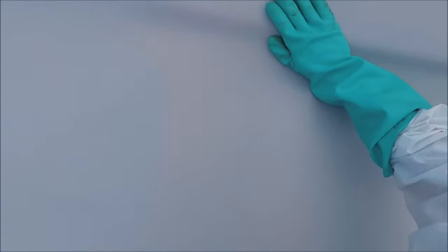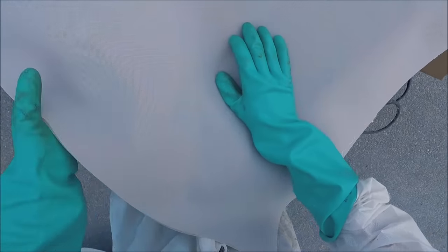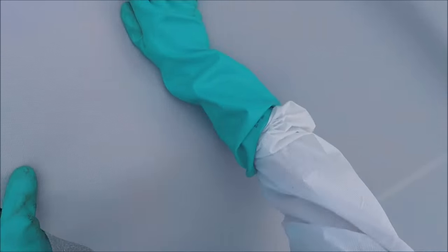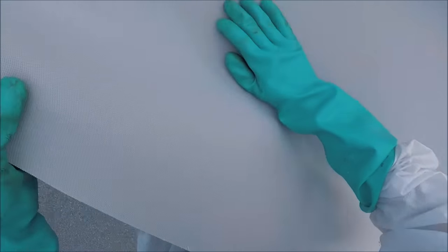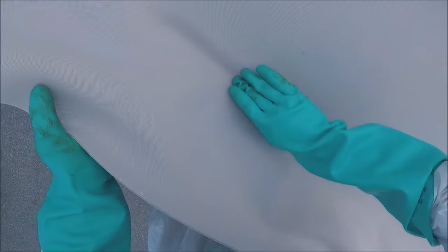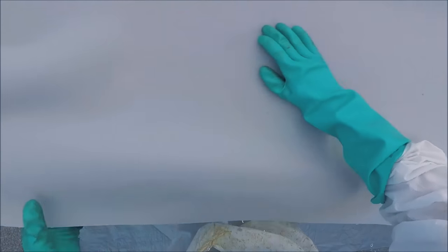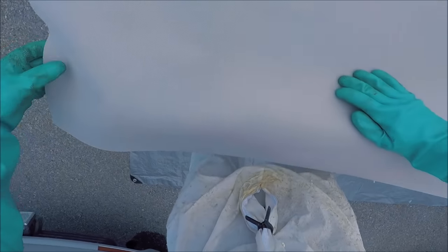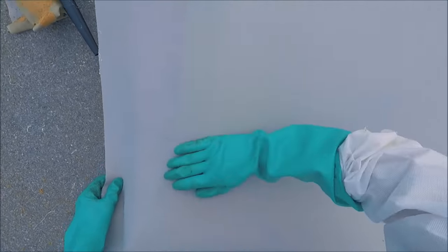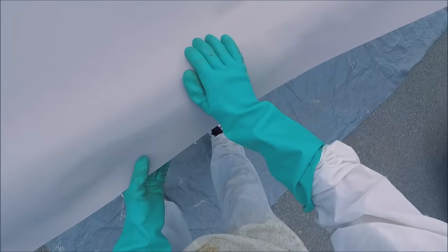Moving ahead, we're adding the material now — just gently feeding the material into all the individual shapes of the headlining board. With this one you've got grab handles where you have to make sure you get a lot of material deep into those gaps. You don't want to place it under high tension because that's where the headlining material may start to sag again. Just feed the material without placing it under a lot of stress when pushing it into those gaps.